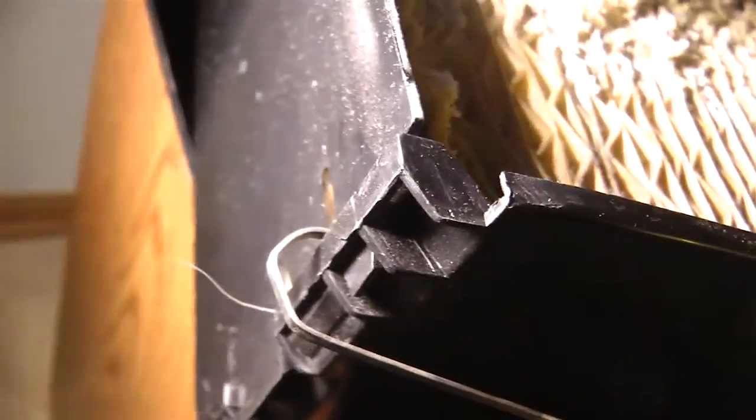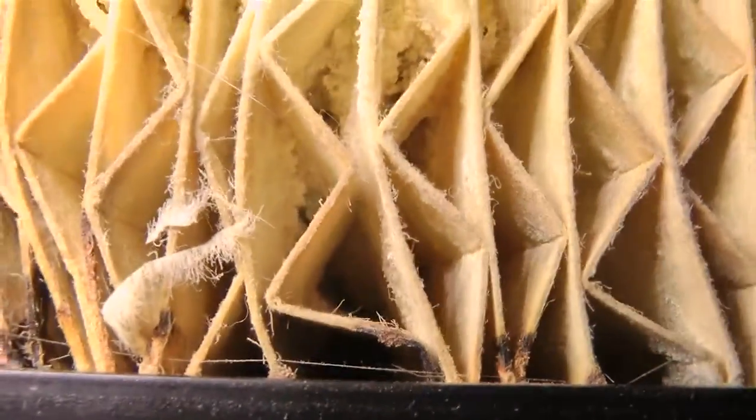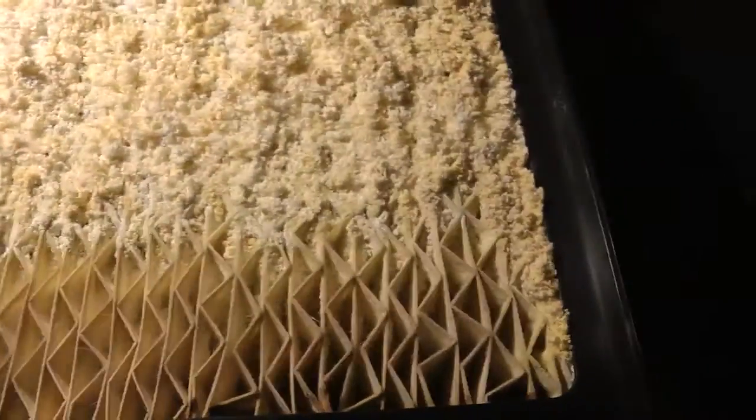Now, as indicated earlier, when we attach the clip lead to this, the voltage from that little wall wart transformer I showed earlier is run all the way across the top of the wick and causes the current to flow down through the wick to that little plate that you saw originally in the bottom of the humidifier. Now, what is going on in here is a little bit complicated, but if you want to skip ahead, that's fine. What you have when you have calcium dissolved in water is it's combined ionically with two hydroxyl groups, two OH groups, which each donate an electron to calcium, which make it happy.